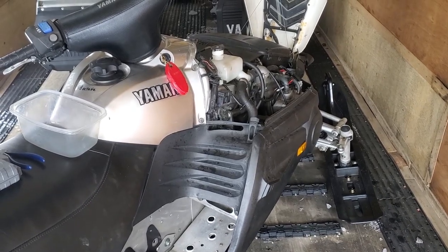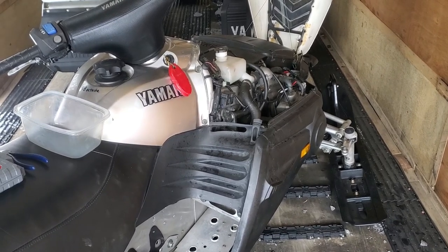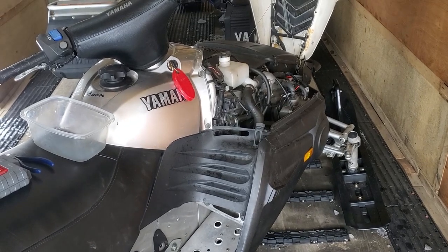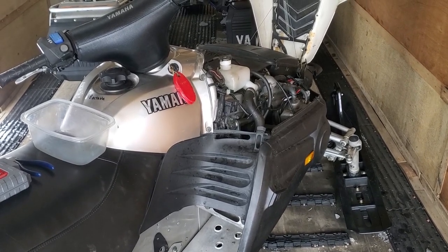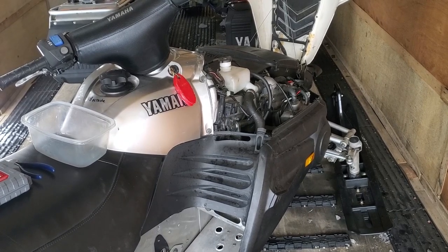But I did notice this year when I changed the oil, there was still a little bit of debris, not anything big, but just very fine little metal shavings still floating around in the oil. And I suspect that they flushed down out of the upper bearing in that area, even though we already flushed it really well, and got into the oil.